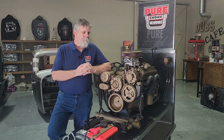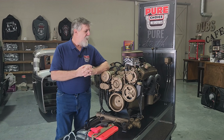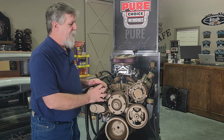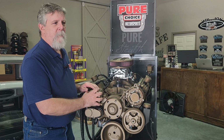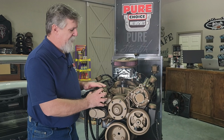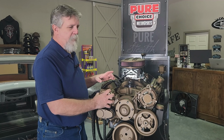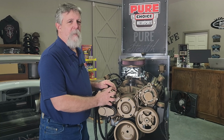One of the worst offenders in my estimation was heating and air conditioning plumbing. Typically, because of the air conditioning compressor being at the front of the engine right on top, generally there's two fittings right front and center on a hot rod engine that are, in my estimation, the worst offenders, and those are the two service port fittings that go on a compressor. This is an SD7 compressor, but the worst to me was the 508 compressor, top exit. You have two fittings coming off of there, typically with 135-degree service port fittings, right front and center when you open that hood, and they're just ugly.